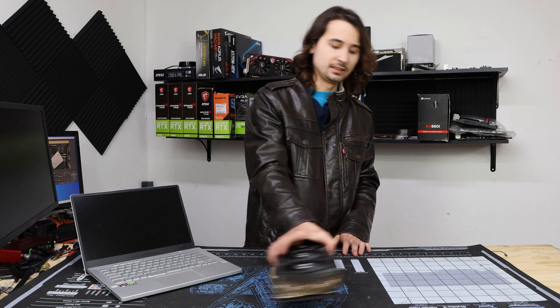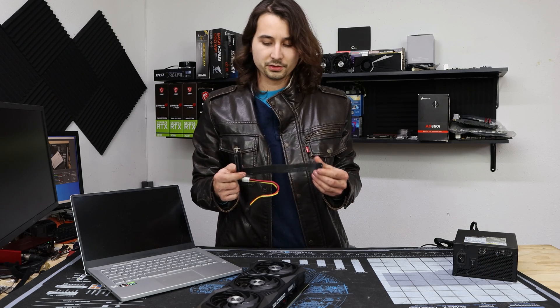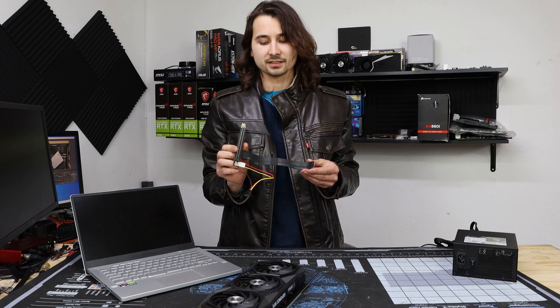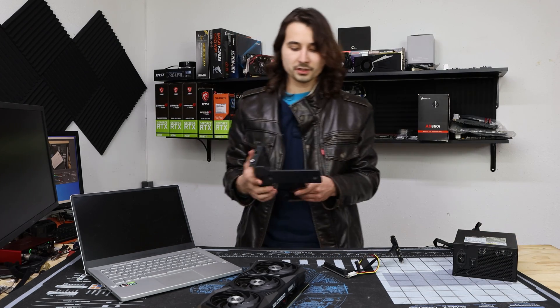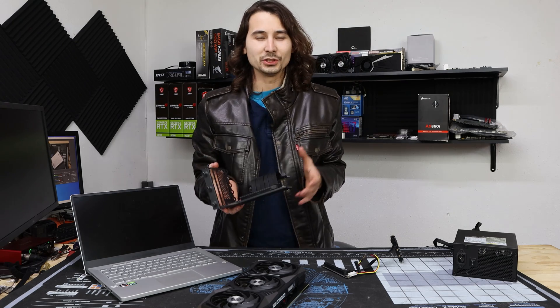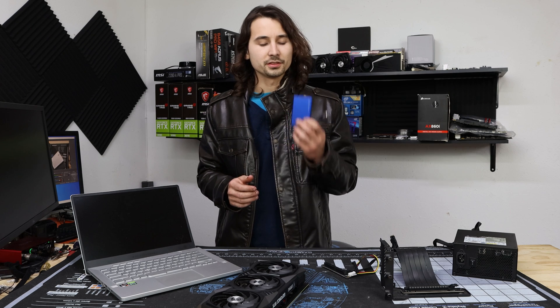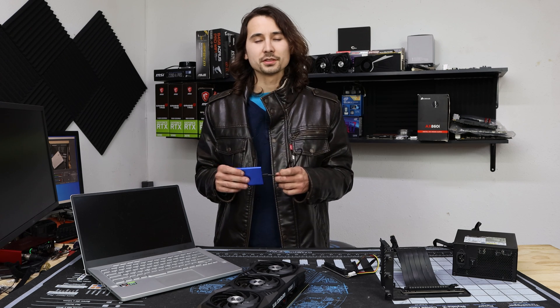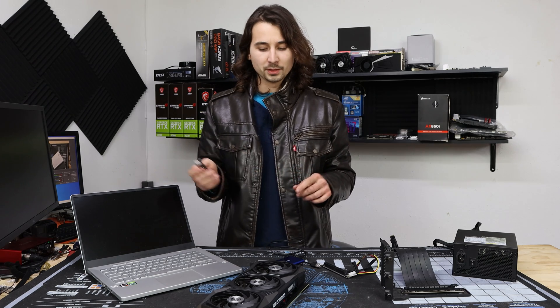So what I'm going to need for this is an extra power supply, an M.2 to PCI Express 16x adapter, and I'm going to use a vertical mount just to make it a little easier — you don't need this but it's nice to have. Because the G14 only has a single M.2 slot, you'll need a secondary storage device — a USB SSD or a USB adapter to an SSD so that you can run your OS on USB. You'll also need a USB flash drive to put Windows on the SSD.